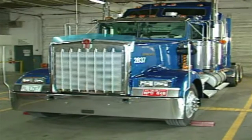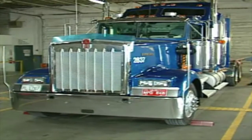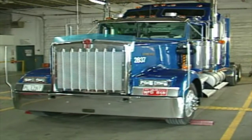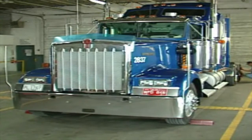Now we move to the back of the vehicle and put the lasers on the tires on each side of the axle. We'll start on the rear axle and then move forward on the truck. So on the left side of the truck you hang the laser bar using the straps, place it directly against the side of the tire, and aim the laser forward until it hits the target and you get a measurement.